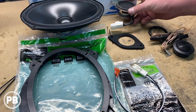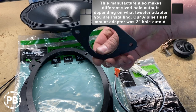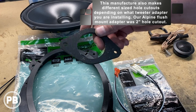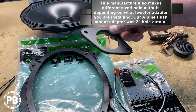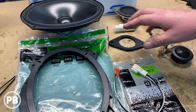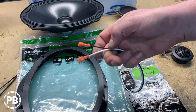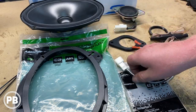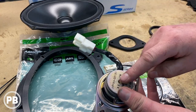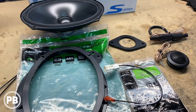Now to mount the aftermarket tweeter in the factory location, we have these speaker brackets for the tweeter that fit perfectly. It's a 2-inch hole cutout for our Alpine Type S speakers. We'll link these down in the description so you know where to pick these up. Essentially all we're going to do is get our speaker mounted into our brackets, speaker wiring harness adapters on the terminals, and this end plugs into the door. We need to actually rob this harness off this tweeter so we can use it with our new tweeter setup. So let's get started.